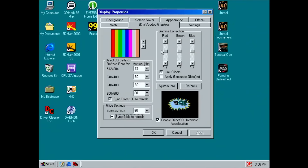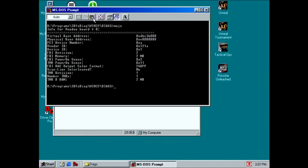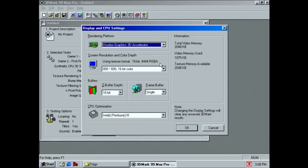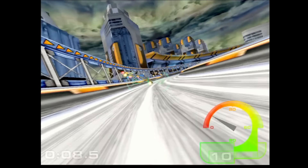The first thing I do once I repair a Voodoo card is to run Mojo. Usually I use Mojo in DOS, but you can also run it in Windows from the command prompt. We have a Voodoo board with 2 megabytes and 2 megabytes — everything looks great, so we can continue with 3D tests. Our Voodoo is detected. Let's change resolution to 640x480, 16-bit color depth, and run the benchmark. The card is perfectly working — it was probably just some pins disconnected from their pads.